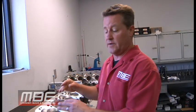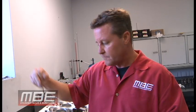On the dyno, you will not see anything. You will not see a loss of power, and you will not see a gain of power. But what we found over the years is that you'll see 4/10 of a mile an hour. For sure, 2 to 3/10 of a mile an hour you'll see. So there is some performance advantage, but the best part is the motor's not detonating, so the motor's happier. And we'd see that at the higher RPM.